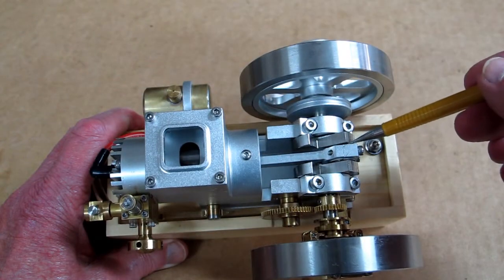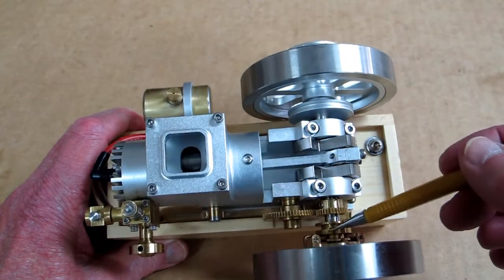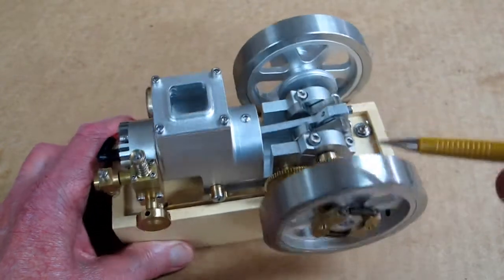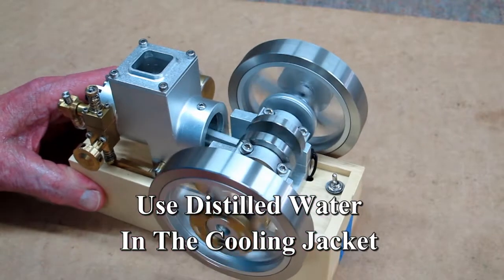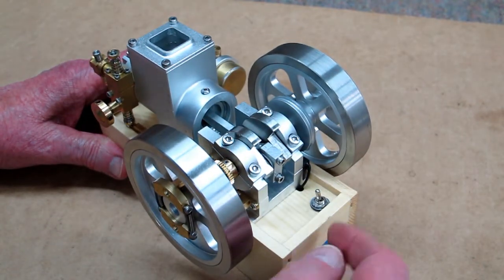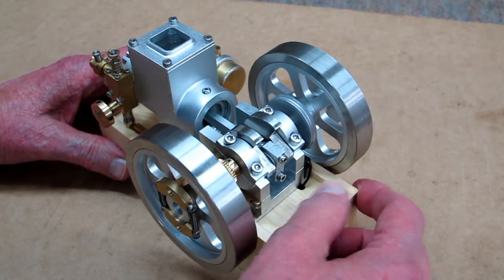The lower end of the con rod is running on a bushing. I put a little oil in there, oil on the gears — anything that pivots, slides, wiggles, or moves, I put oil on it. These do sling oil around a little bit, so I put it on a piece of cardboard. They have also reversed the position of this switch — this is off, whereas on my M92, this position would be on.